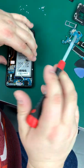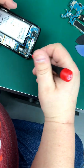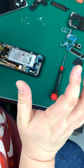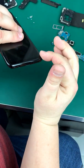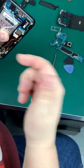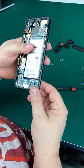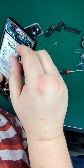Construction-wise, this looks like the S7. Here's the nicest thing — you don't want to call this a home button cable. The nice part is, on the old S7s and S6s, dating back as far as you can remember on the Galaxies, you'd have the charger port here and these two little ribbon cables that would fold over — those would be your light sensors for your multi-window functions. Your home button would be a cable that went up underneath the LCD, and that would be impossible to fix in a lot of cases.